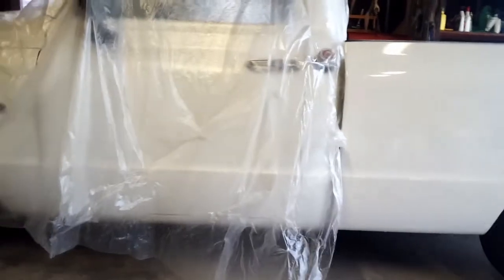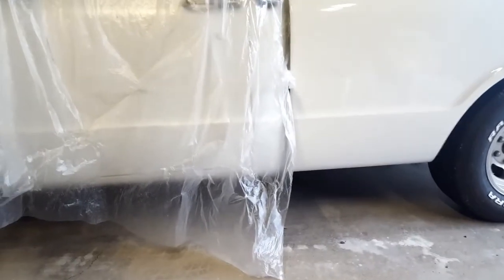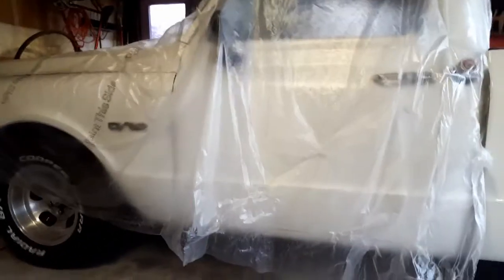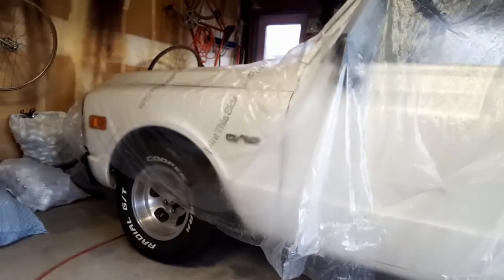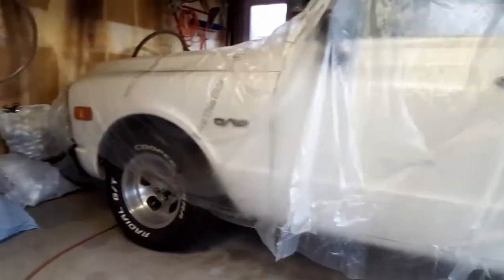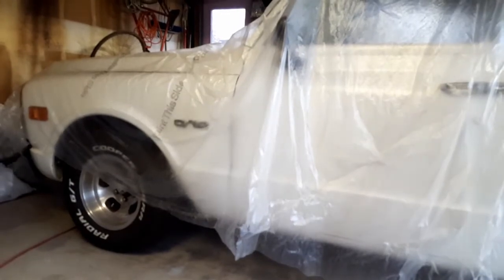There's a lot of key elements that you should consider, which is going to be make sure the whole ground is wet, make sure you have ventilation, make sure you have an escape route for the fumes. You know, get a fan and put it on your side garage door over there. Make sure you have a screen door or something. And on your garage door, you can put some filters at the bottom, and you can do it that way. That way it prevents a lot of dust or bugs or anything like that to come in your garage. I'd suggest you put a fly trap before you start spraying. That way, if there is any little flies or anything floating around, that fly trap will catch them before you go ahead and spray.